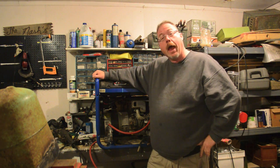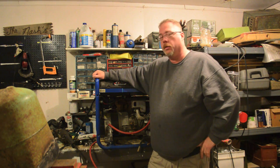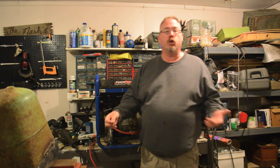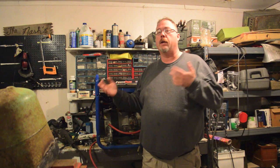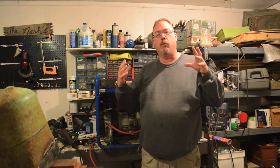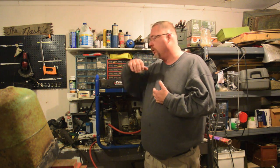Before I show you how we did it, let me tell you why we did it. So if you've got a generator, you've got to have gas. Well, gas is hard to store, because when the temperature gets hot outside in the summertime, all the volatile organic chemicals evaporate out. You've got the big bulge in your tank — that's the stuff that makes the thing run. So as you store gas, it gets harder and harder to use. The quality goes down, especially with the ethanol gas that we get now because it attracts water.